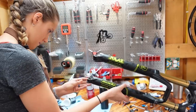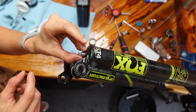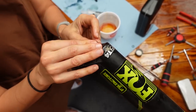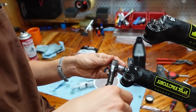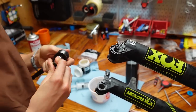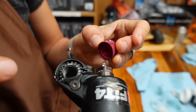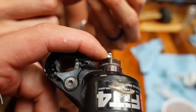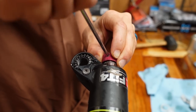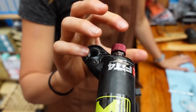Make sure those pistons pop through. Then install the crush washers and screw on the lock nuts — they'll pull through as you tighten them. Once it tops out, do about an eighth to a quarter of a turn — that's the crush washer crushing. Don't overtighten. There's a little notch on the rebound part that sticks out, and the screw lines up with that notch — tighten it and wiggle it back and forth so it falls into the notch. Set the rebound clicks back to eight from open.